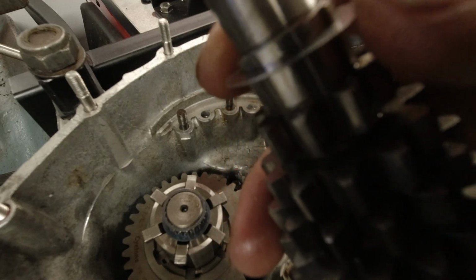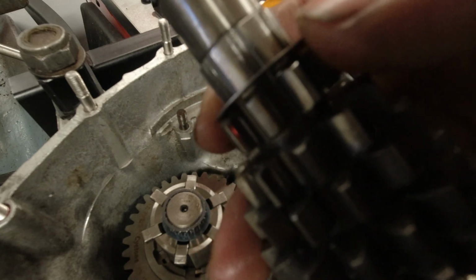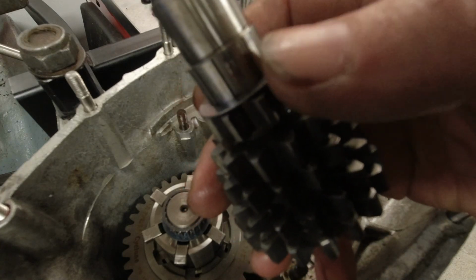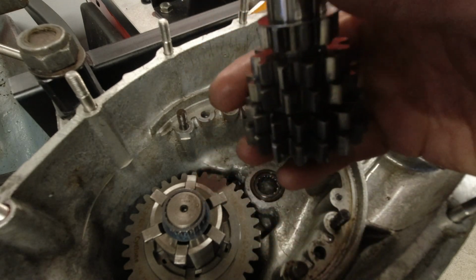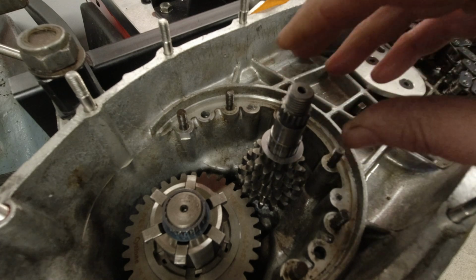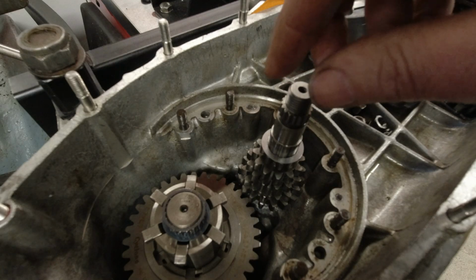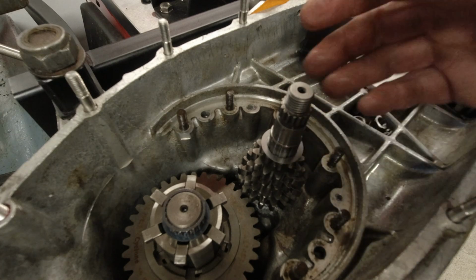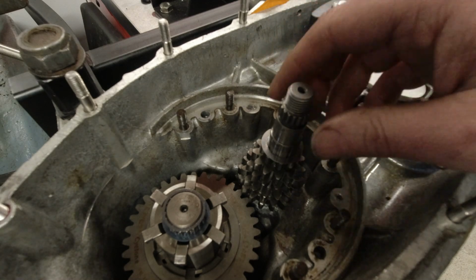If you get one of the older DRT 5-speed gearboxes, I think they came with 2 or 3 of these shims. But the instructions say you should try to fit the fattest one first, because when you put this into your engine and tighten up the gear cluster with your clutch whatsamajig, you pull that up so that it sits flush on the back of the end plate. And this is sort of what you shim the height of the Christmas tree with.